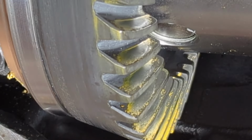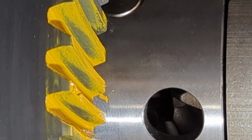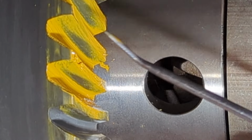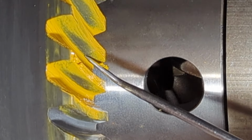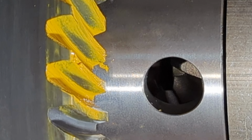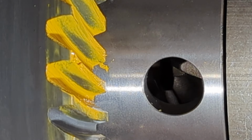And then let's get up to the drive side pattern. As you look at that, it's a little more evident here that we have these harsh lines right through the root. And then we have that frowning face of that sunset, which is still telling us that we're just a little bit too deep. So I'm going to drop another 5, see where that puts us, and run another pattern.